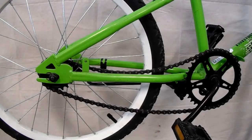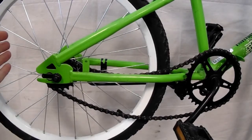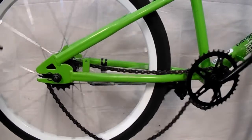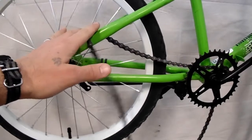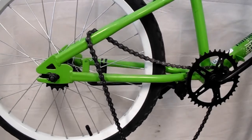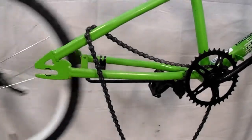On a single speed bike, one thing you can do to make your life a lot easier is to move your chain out of the way. Move your wheel as far forward in the dropouts as it'll go, move your chain off of that front chain ring so it's hanging loose, then take your chain and just loop it up over the seat stay just like that. That gets the chain out of your way, and when it's time to put the wheel back on, your chain is going to be in the right place to do so. From there, you can just take your wheel and pull it off the bike.